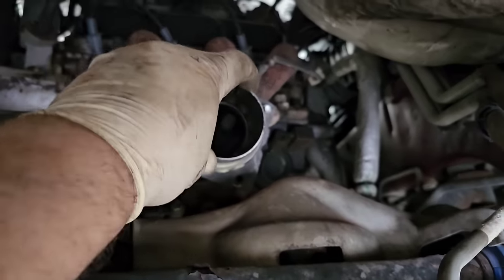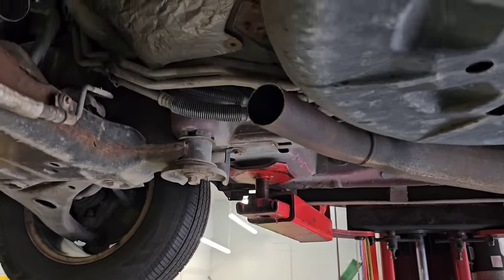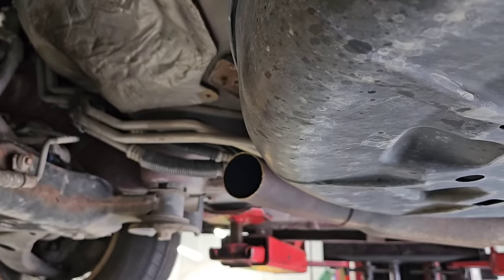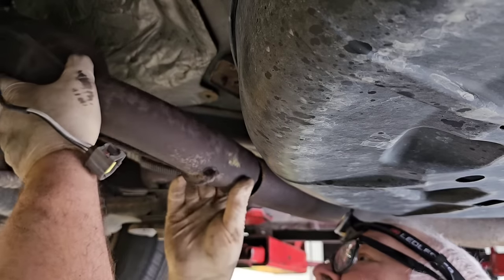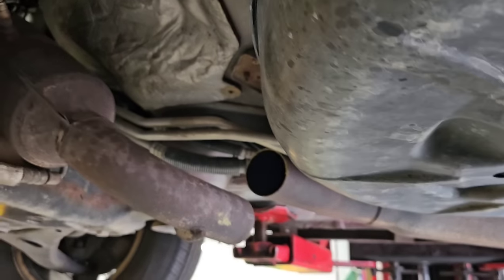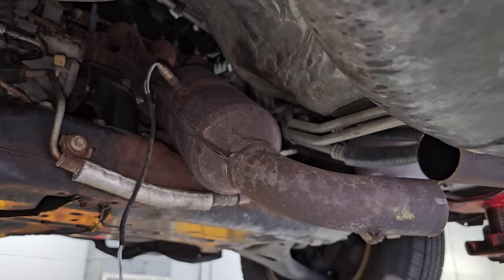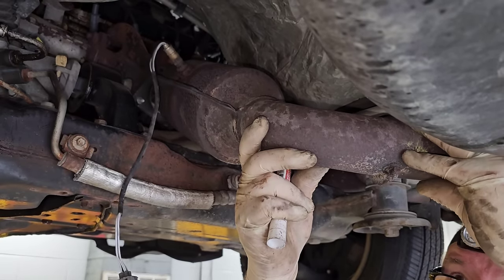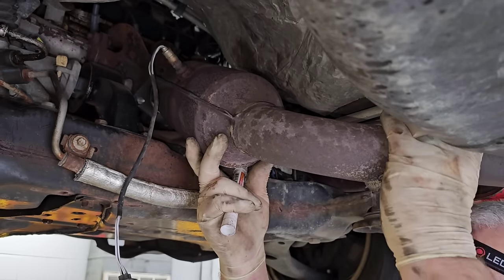Okay, so I've got that flange up in place — just put the screws in by hand to hold it for now. I want to get the cat pipe up in place. It could come down just slightly to line up to this pipe. Now what I need to do is get something to mark up there. Let me get my paint pen. I've seen on the Internet they make these clamps that you can put around exhaust pipes like this, clamp them together, and they have open spots so you can weld it — man, that's a fantastic idea. I may actually look into getting something like that.